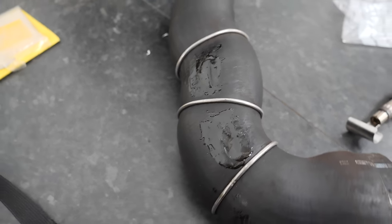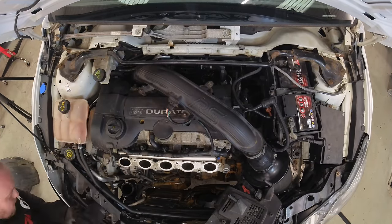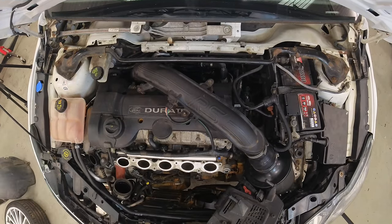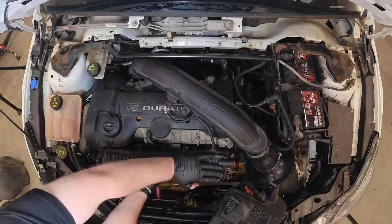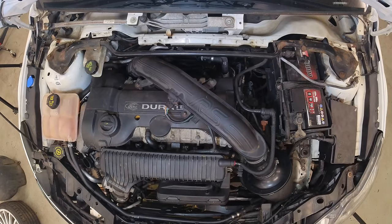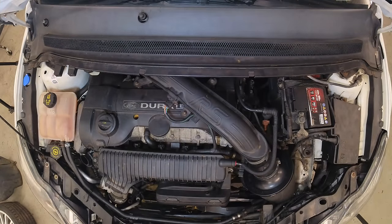New ABS sensor loom on and secure. Now I need to put the rest of this car back together. Not the prettiest, but it's saved over £150. The flexible glue has filled the divots in and made sure it won't burst through. I built those pipes up from the bottom of the intercooler, then on with the plenum — even with a good idea of where the bolt holes were, it was still pretty fiddly. Once that was all bolted up and the jubilee clips tightened, it was time to put the ECU box back, then the driver's side headlight, and make a start replacing that scuttle panel. Not a single bolt left over — got to be a first on Evil GT.